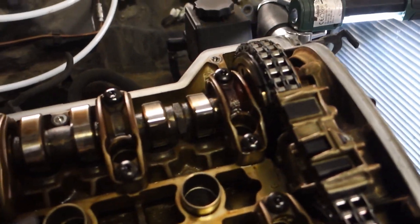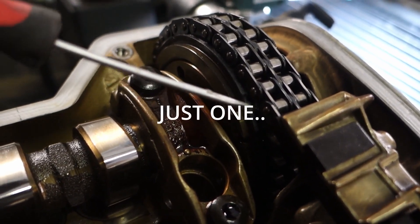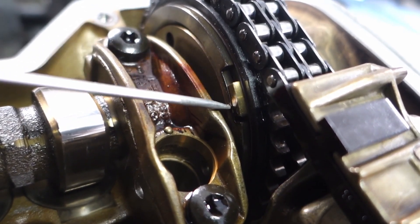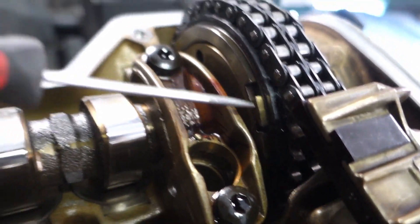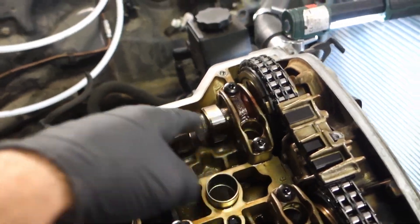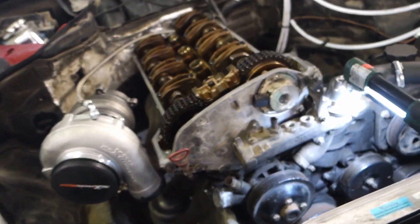The second thing where you can easily fail is camshaft position in the VANOS. First you need to understand: this part is the VANOS, and this part is your camshaft. We want the VANOS to be advanced all the way to this side. Right now it's wrong, and if you try to set timing your timing will be wrong. You need to retard your camshaft to maximum position. Take a wrench, retard to maximum position, and now we can check timing.